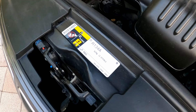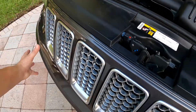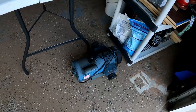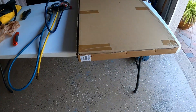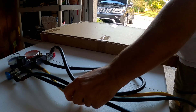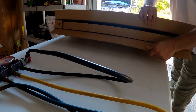I ran it like that for a couple months, just adding it until I got the new condenser — it ran fine. Then I converted it back to R134A. I don't know why they changed it, honestly. Every time you go to the shop they want to charge triple or quadruple to add freon. So I converted it back, it worked perfectly for a year, and now the condenser went bad again. We already got the part. We're removing the whole front clip, which is time-consuming. We have an old-school vacuum pump, new part, and gauges. Let's make sure it's the correct part before taking the truck apart.